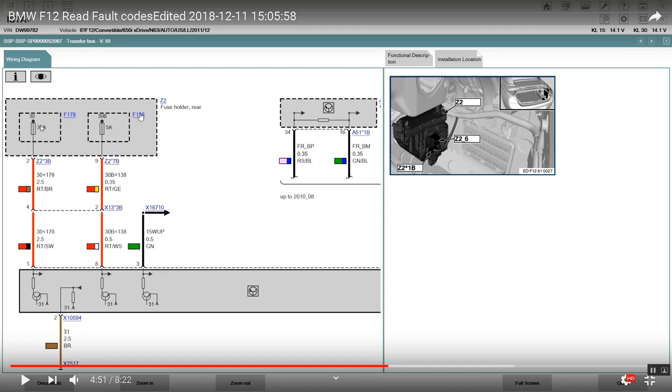The 30-amp fuse 178 and both fuses look good. The terminal 30 direct connection is always on — we can probe this with ground to test. The ground won't be measured from the rear distribution touching the body of the car, but to force-test the ground going to the control unit we need to trace that ground connection. We check for corrosion, water ingress, or green oxidation buildup — clean it with sandpaper or a wire brush, then run a continuity check. If the meter beeps continuously without hesitation, the ground is solid. Intermittent beeping indicates impedance in the electron flow, meaning there's resistance in the ground.